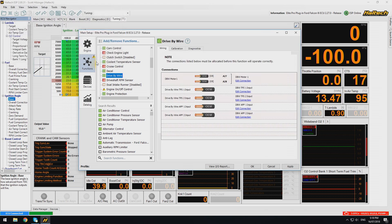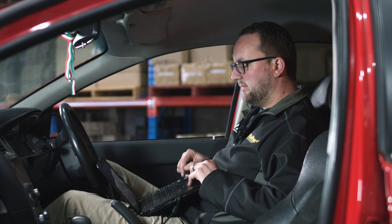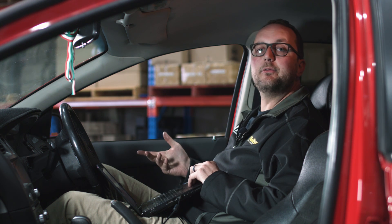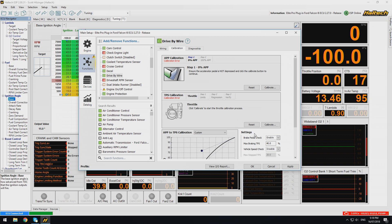Because it's an electronic throttle car, I'll calibrate the electronic throttle. Step one: zero actual pedal position — done. Now full throttle, 100%: I'm holding it to the floor and pressing calibrate. Make sure to press right down on the pedal because if you don't press it all the way into the carpet, when you're racing at the track and push down a little harder, it might go into a limp mode because it doesn't know to go that little bit further. So make sure to really press the throttle down hard. The next one is a throttle body calibration — clicking on that, you might hear the throttle body clunking back and forward. It takes about 30 seconds and maps out that electronic throttle so it's got all the right parameters for this particular throttle blade.